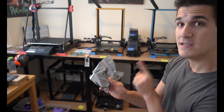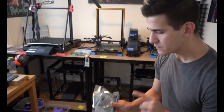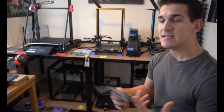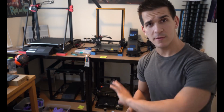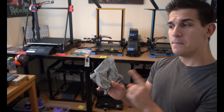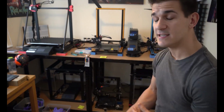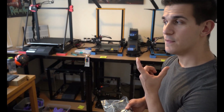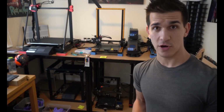Turns out the Ender-5 Plus and the CR10S actually share the exact same mainboard, just depending on the firmware you get. Now, we're not gonna be flashing this firmware. You guys will see TH3D and Tiny Machines firmware and all this upgraded firmware. From the research I've done, and if I am wrong, please let me know in the comments, in order to flash the mainboard on a touchscreen Creality printer, the Ender-5 Pluses, the CR10Ss, you typically need to get a whole new touchscreen because the touchscreen systems on them aren't compatible with the upgraded aftermarket firmware. More into that, you can Google and research that.